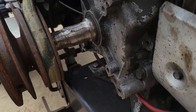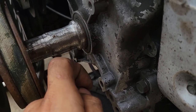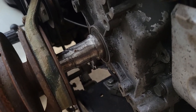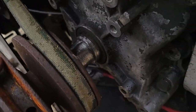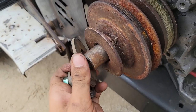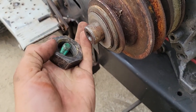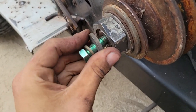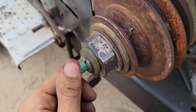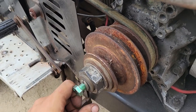I just got this ground down - started it up and ran a grinder across here to get that. It used to be that size because this is a vertical shaft it used to have a bigger oil pan, and since this is now a horizontal shaft this had to get cut down. So this pulley will fit right on top of it - it's kind of tight but it will go on. And then I have this contraption of one washer, another washer, a gigantic nut, and then a bolt with another washer on it to go on the end. I'm going to put an impact on here and tighten this thing down so it will not come off unless I take it back off.